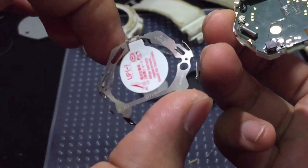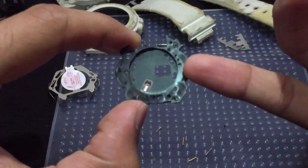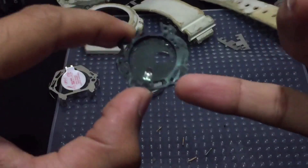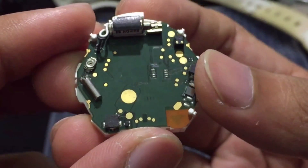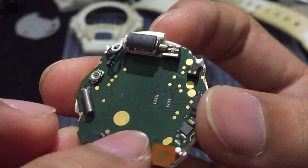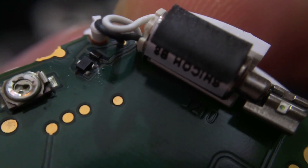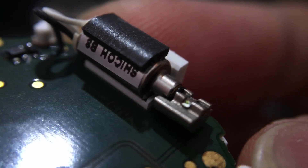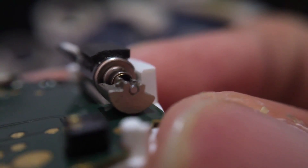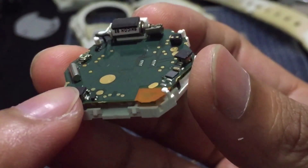This is the first compartment which holds everything in place. This is the battery compartment where three or four springs connect — two over here, one here, and one down here — connecting to the circuit board. The circuit board has code '1 1 1.' This is probably the regulator for timekeeping. This is the vibration unit — it has the brand 'SHICOH' on it — and that's the counterweight that rotates each time the watch receives a notification. It is literally wired all the way down to the circuit board.